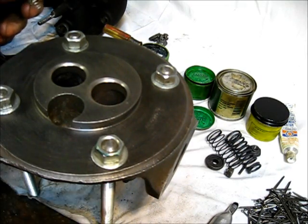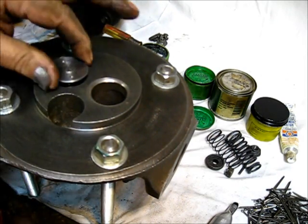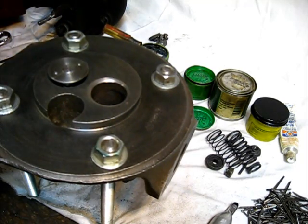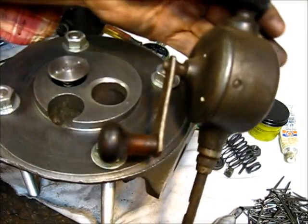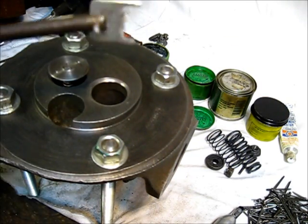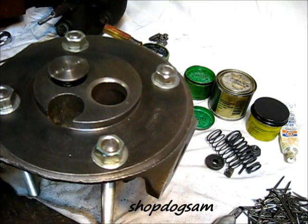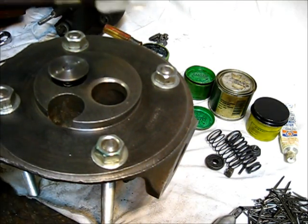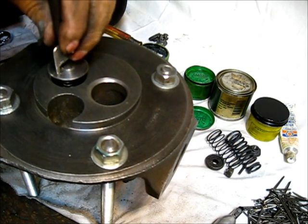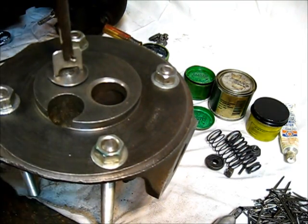The correct way to seat the valve — and this is not a how-to, it's just the way I do it — is with a light-duty spring. On these valves I did drill two pivot holes in the top. This thing right here is a real old valve grinder. When you turn it, you can see it goes back and forth — it never makes a full revolution, and it always moves to a different position. You position this on the valve face with the two pins down into the holes.